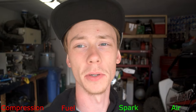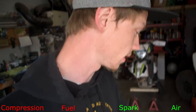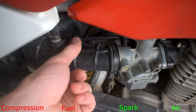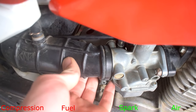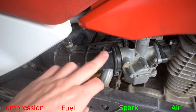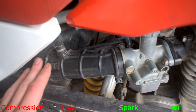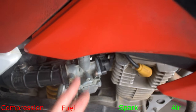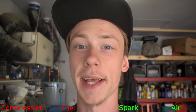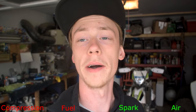If there's any debris inside the intake you're going to want to pull it all out and clean the whole intake out really well. Something to really watch out for on older bikes is this intake boot — as they get old, the rubber becomes stiff and hard. It should be nice and pliable, soft and squishy. If it's hard as rock it's going to be brittle and susceptible to cracking on the trail, and then you'll be sucking dirt and debris into your carburetor. You need a controlled amount of air mixed properly with fuel to run correctly. Make sure your air filter isn't too dirty and avoid cone-style filters — get a genuine uni-style filter instead, as those cone-style filters are junk.